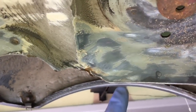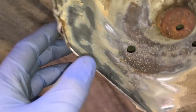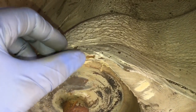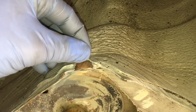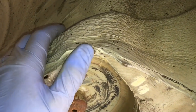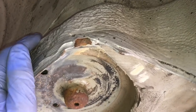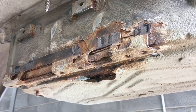I've now started taking off the corrosion on that little example I just showed you — that was building up underneath the seam sealer even though there was no impact on that area. It was all coming from flex of the panel making a bare metal area. I said there wouldn't be much under there but there actually is a decent amount, and it probably goes on further — that's just where the seam sealer's broken off. If that's left or painted over, yes it might slow down, but you're just trapping corrosion there. It just isn't as good as removing the loose corrosion and treating it first and then doing your paints and seam sealers on top.